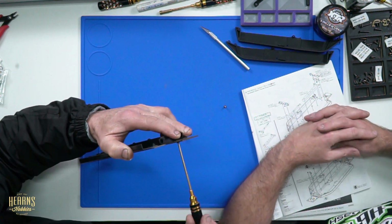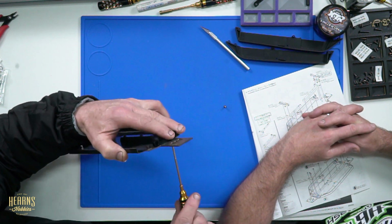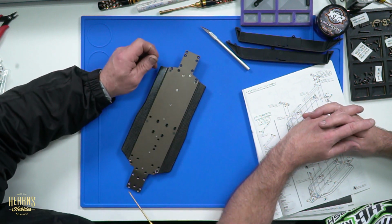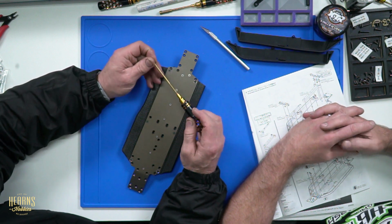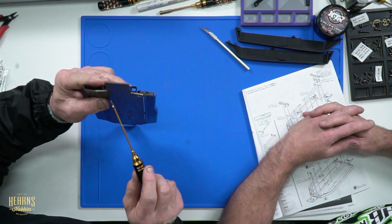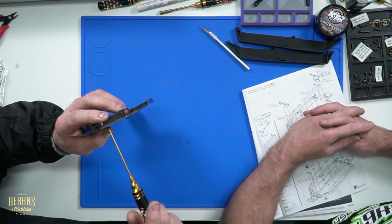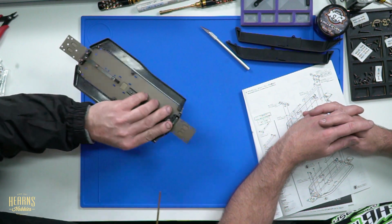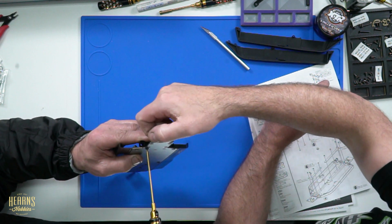Do you want to put a bit of paint pen on there? Nope. In stock, you leave the tie screws in the A, B, C and D blocks. Really? In modified, we take them out and put steels in. Not in this car though. You're not going to crash this car? We will have steels in the back. In the D? Yeah, where it's going bang on the ground. They don't leave a lot of meat in there for the D block.